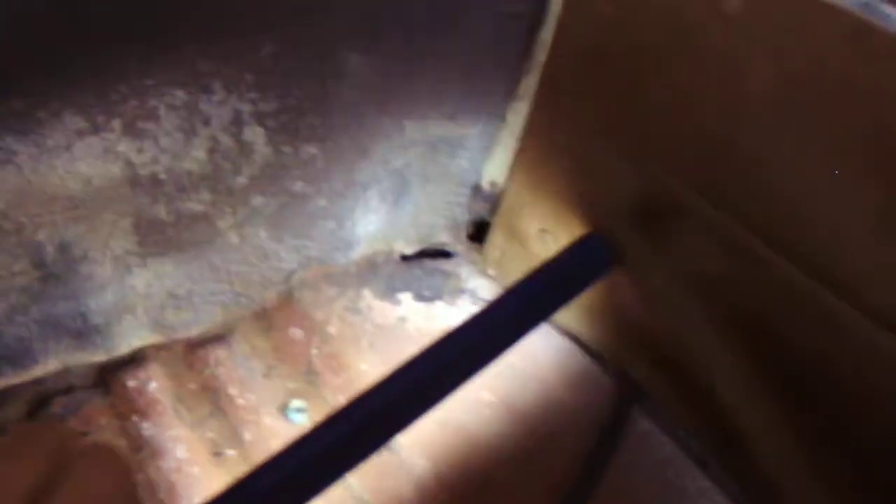Just while we're inside, this B-pillar here has got some rust that I've found hidden under this mat — I've dug all that out and it'll have to be welded up. Always pull up your mats to have a look. This side, there's some rust holes there. The window seals are all leaking — they may look fine, but the water does seep down and then get trapped and start rusting out the floor. With the middle seat, it gets attached to the floor — there's a low bit there, so all the water will sit there, and with all the dust and dirt, it'll start rusting out your floor. Make sure you check those.